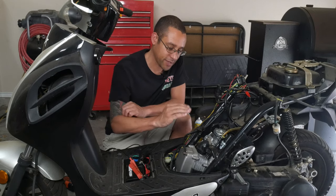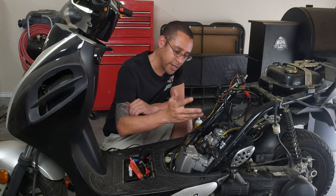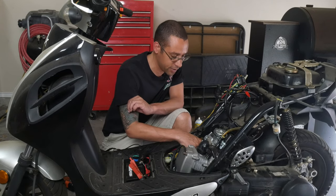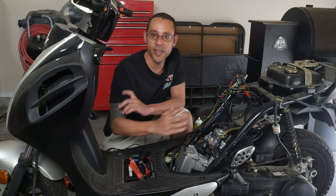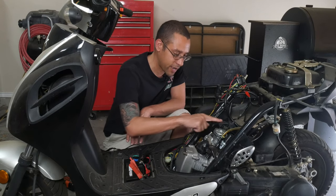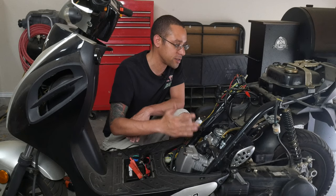Right now I got the cylinder on, new engine upgraded, the carburetor's on, boots on. Can't get a racing carburetor on here just because of clearance right down here at the bottom, so that's going to stick with that. I did open up the jets, got as big a jet as I can in there to be able to tune it. Everything's hooked back up and I should be good to go to run it, and I can start tuning it.